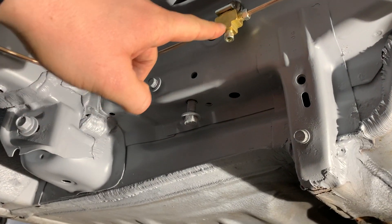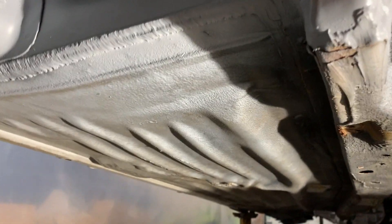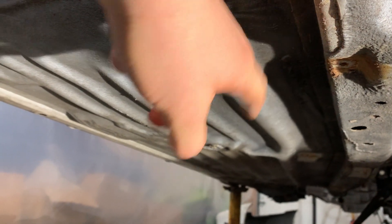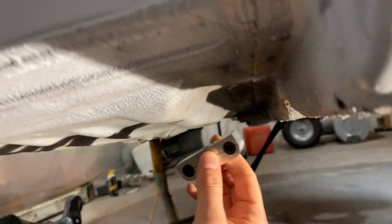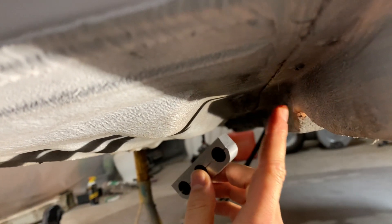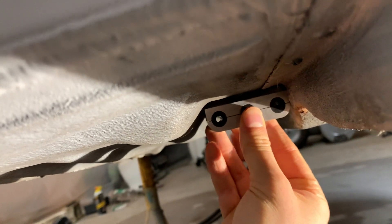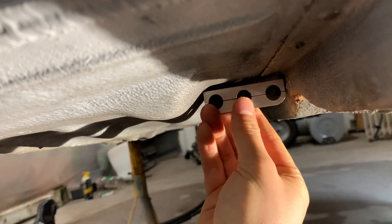Under the car, this is where my brake line needs to run - down here, we're going to do a bend, and then go to about right here where the factory mount was. We're going to take one of our aftermarket clamps and mount it right in there. Looking down where the brake line and fuel lines would run, this almost fits but it's just a little bit off. I'm going to try to scrape off some of the factory coating to get it a bit further over, and we'll probably have to trim it.